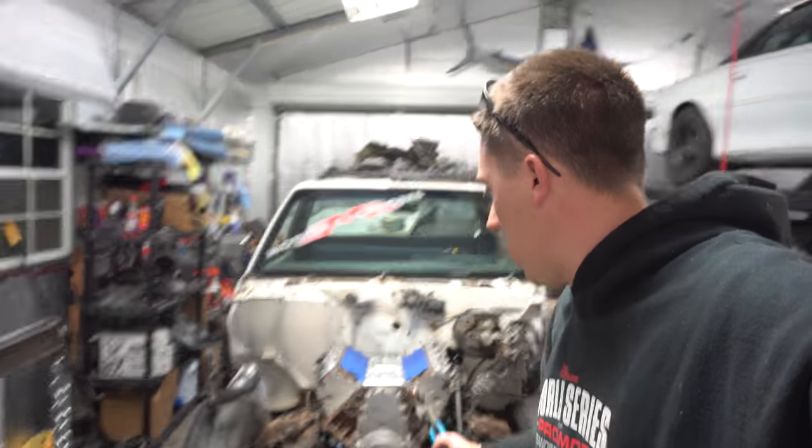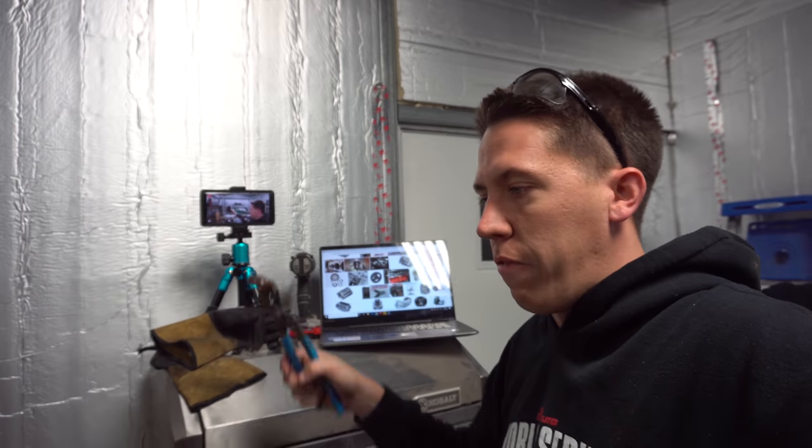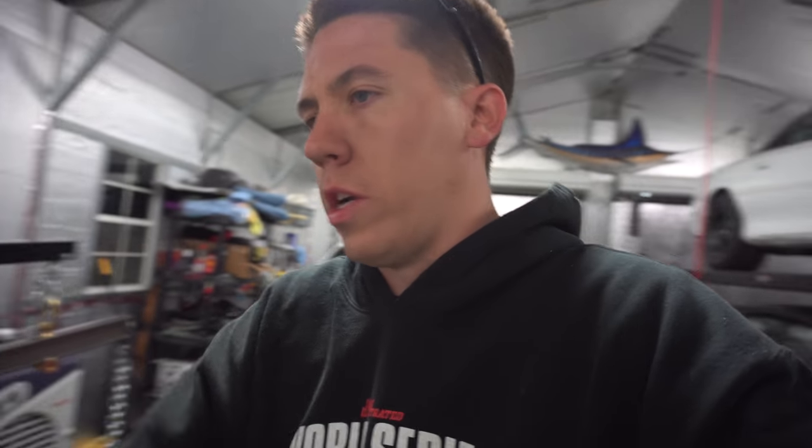Fast forward about a good hour after we got the engine in — we went to go put the converter in and found this little adapter ring sitting in the back of the crank. Thanks to the live feed, viewers identified it as a repair sleeve that got stuck in the back of the crank. The disc didn't look right and I couldn't find any pictures, but it's a repair sleeve, so that doesn't line up and can't stay in there. We have to grind a notch in it and peel it out of there, and then we should be able to get the converter and transmission in.